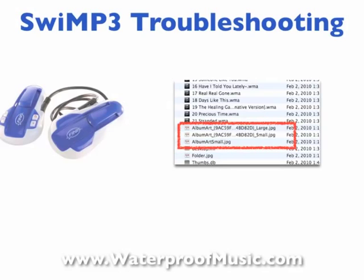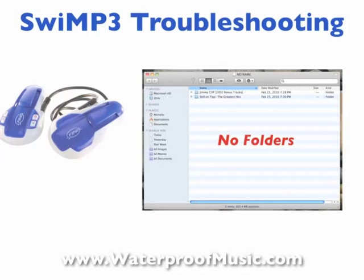You do not want to have files stored on your device that are not music files. This is an actual screenshot from a customer who sent back the player saying it wasn't working — and in fact it doesn't work simply because it can't make music from a JPEG or photo file. You definitely want to make sure you are using WMA and MP3 files. Remember that iTunes files encrypted in the AAC format will not work either — you need to convert those to MP3 first. Also, you can't use folders; the player works file to file, and if it hits a folder it can't open it, so it simply stops. Open those folders and make sure everything is in the root directory — the very first directory you see when you open your drive.